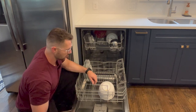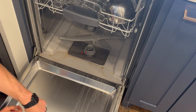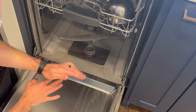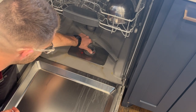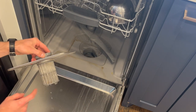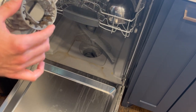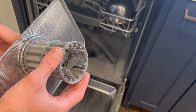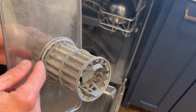Dishwashers have a filter in them — 99% of them. This is a Bosch dishwasher. It's a little bit dirty because coffee and everything just drains down and lands here. That's okay for a day or two; it's not going to smell that bad. Most dishwashers have a way to clean them — you can flip that over and pull this little guy out. This is a catch basket right here. This one's decently clean, but sometimes you'll see debris inside or on the outside. You can see the stuff it has collected — those are the non-dissolvable or non-water-soluble items that don't go down the drain.